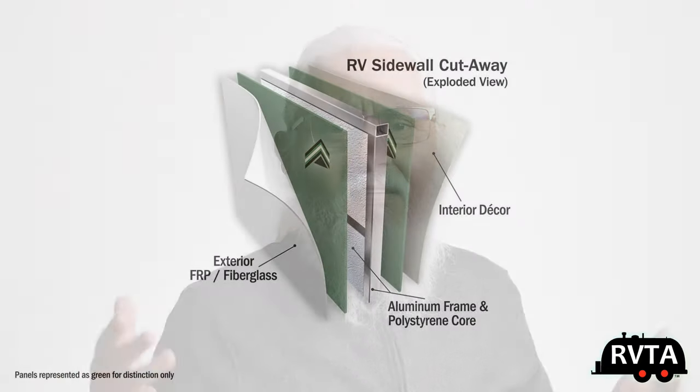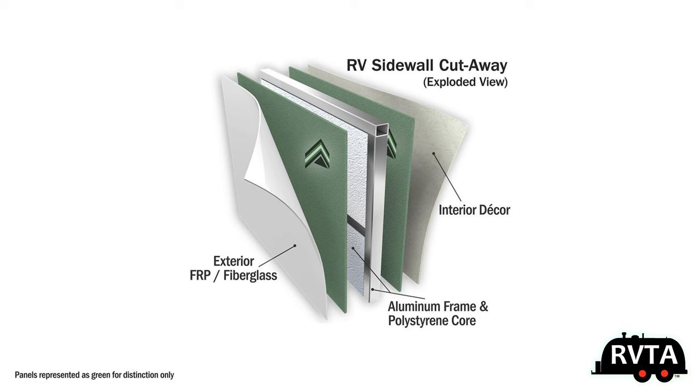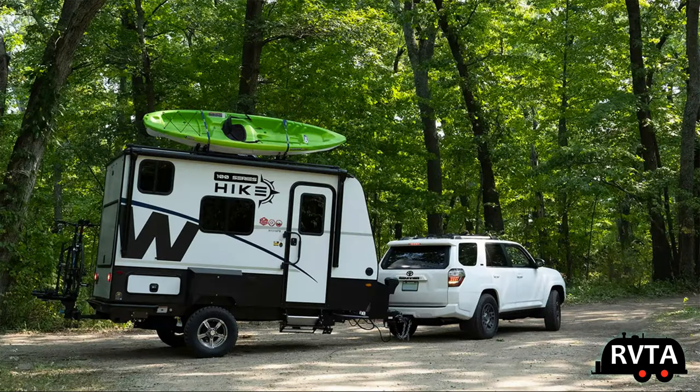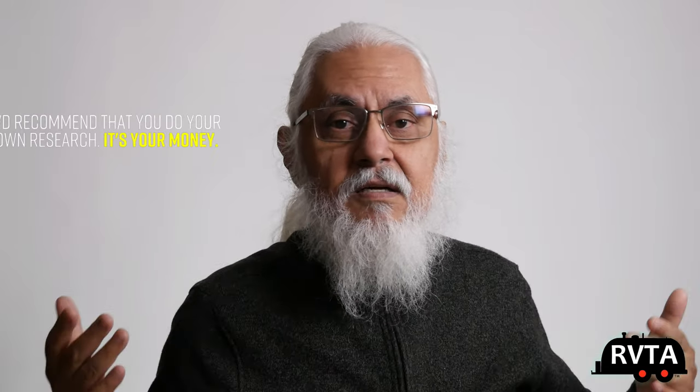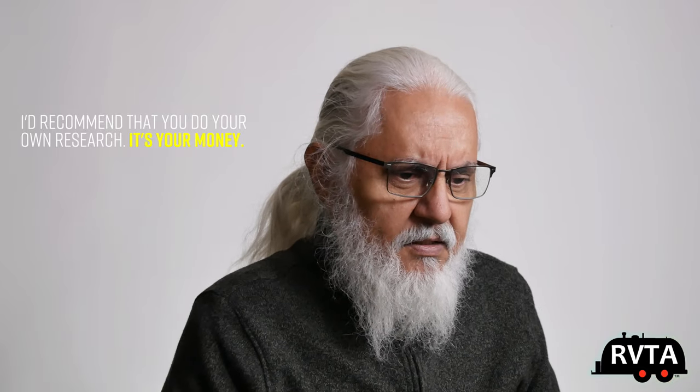They replaced it with Azdel, plastic. And as you very well know, most plastics don't absorb moisture, so you have less chance of delamination. A good thing. So they laminate that and sandwich it in the machine, and they either vacuum bonded it or roller pinched it when they create their RV. Most contemporary travel trailers have an aluminum structure. Some still have a wood structure that is laminated, but most, from what I understand, have aluminum structure. And they put a foam block inside for insulation, and on the inside, another layer of walls. So you have sticks and tin, and laminated.